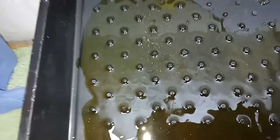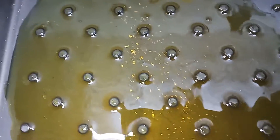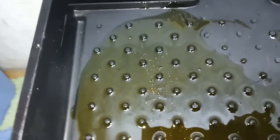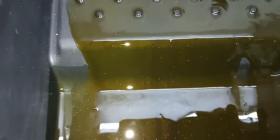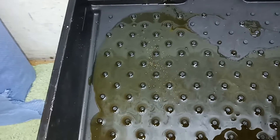I've been draining the oil out of the gearbox and you can probably see flakes of bronze in the oil — it looks a bit like metallic paint. That would suggest there's a bush wearing — probably a phosphor bronze bush in the gearbox. It's a bit like looking at what comes out tells you a lot about what's happening inside, so it could be a problem with one of the bushes in there.